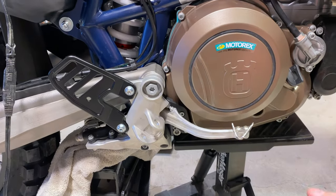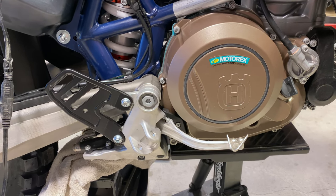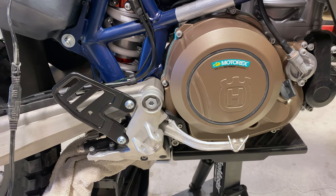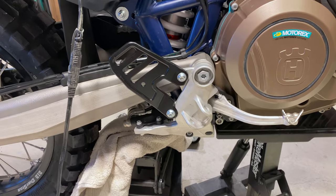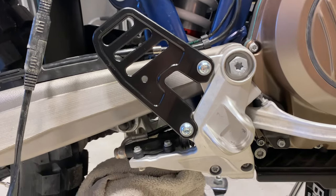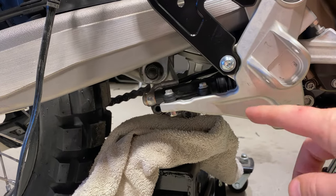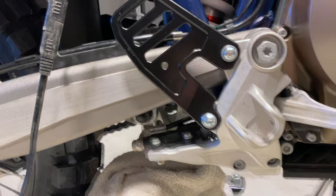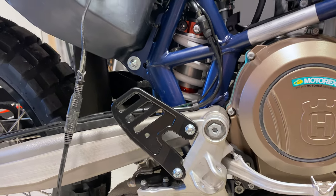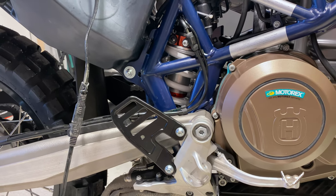Here's the OEM brake lever. It's kind of hard to get to, and I figured the best way to get this thing out would be to do what one guy did — remove this side piece here, basically this whole bit, maybe even leaving the brake line connected, but pretty much just removing these bolts to get this off. It does require unbolting the swing arm, and this may be a one-time-use bolt, but I'm just going to re-torque it back to spec when I'm done. Let's get started.